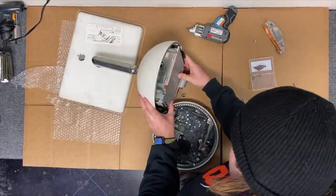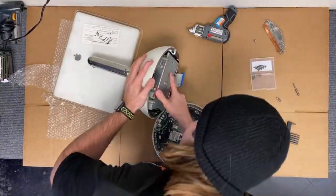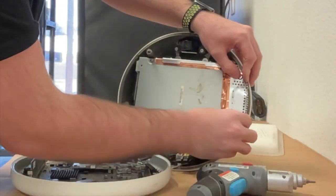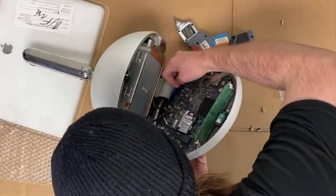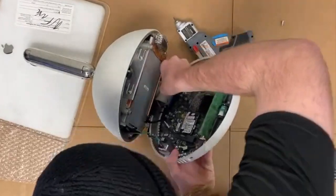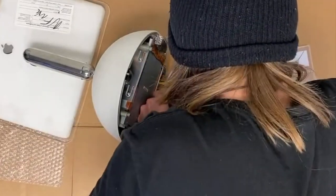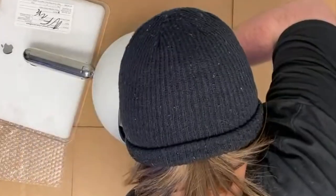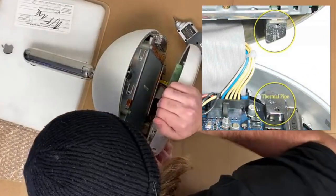Now we just assemble the machine the way we came in. We carefully and patiently tuck the drive back into place, then screw all of the T10 screws back and reattach the drive guard. We then make sure all of the cables are plugged back into the motherboard and line it up correctly. It's not required, but we recommend re-applying the thermal paste on the G4 CPU. It's a little different than most computers due to the narrow long heat sink over top of it. Thermal paste actually goes right here, where the heat sink touches the metal frame inside the computer to dissipate heat.